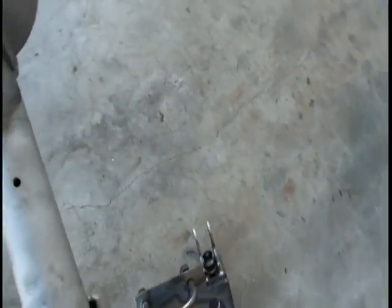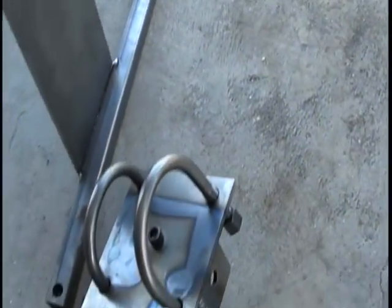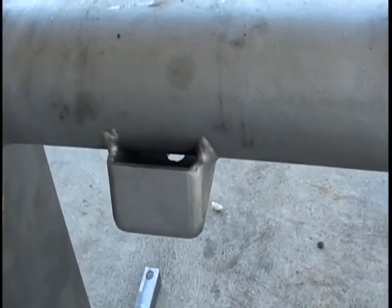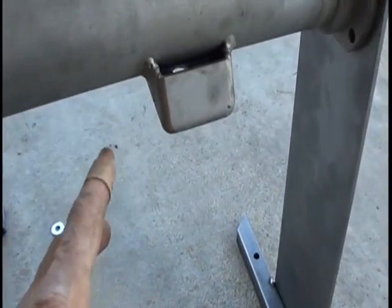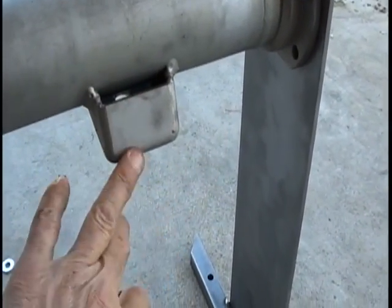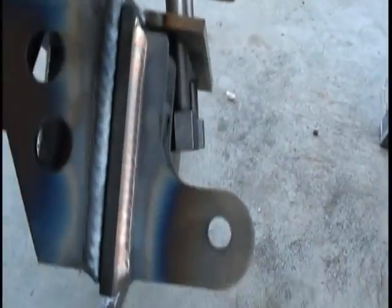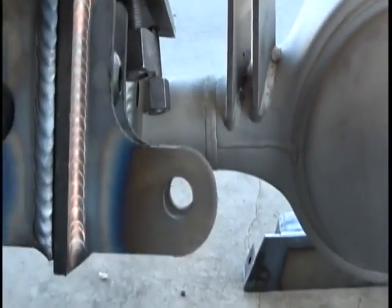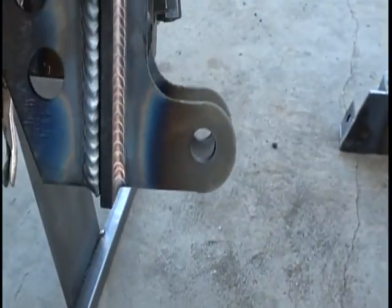Okay, the brackets we're talking about are your U-joint brackets, your coilover brackets. They'll go right around the existing pad where your leaf springs were. That's your factory mounting pad. You'll just take your leaf springs off, throw those away, leave these pads exactly where they were. All right, now I'm going to install these with the bracketry. This is where the coilover ear mounts. It's going to go inward toward the pumpkin. Driver's side will be in, passenger side will be pointing in, because the coilover shock will run from this point upward.